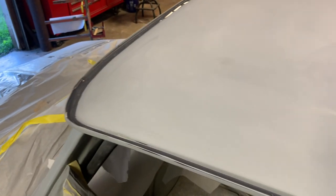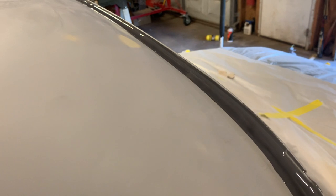We'll go around and sand over it just a little bit — there's a little edge I want to get off before I prime. You want to prime over it so you can see what it's going to look like. Once it's primed, we'll know if we're going to leave it or mess with it some more. So that's the high-build self-leveling — it's going to leave some ridges and stuff where you can see the spot welds. We may sand that down, get rid of any flaws we can find, and put the self-leveling on top to let it just smooth itself out.